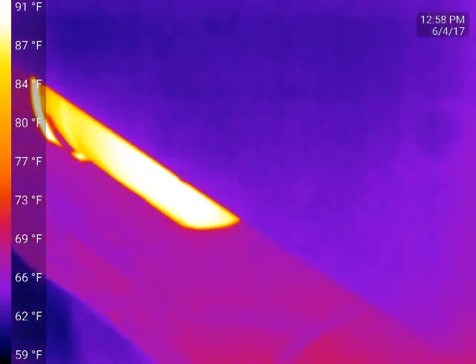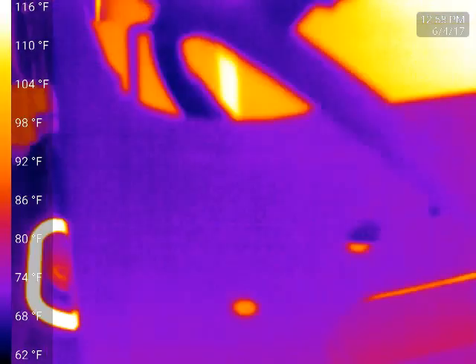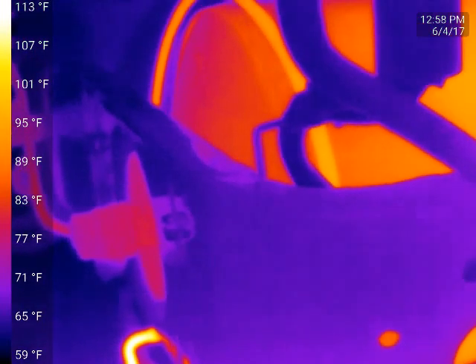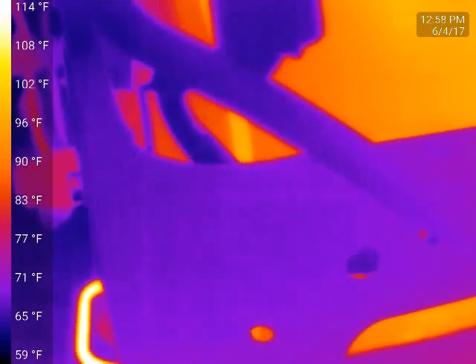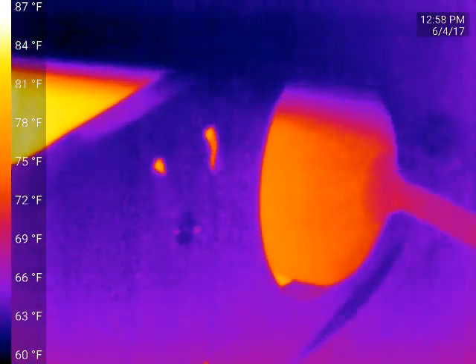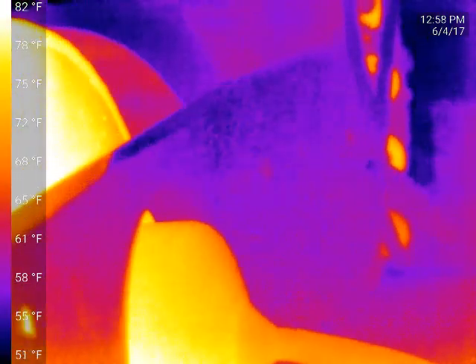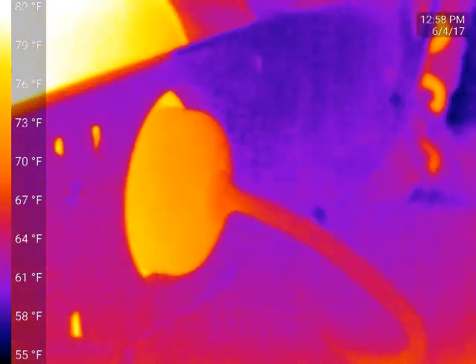While that warms up, this is a 1947 GE, and it actually just kicked on here a few minutes ago. That really bright one down there is the discharge line, and then the compressor itself — it's a horizontal hermetic compressor with external springs. You can see some of the air-cooled condenser up there, and if I get in the right spot, you should be able to see the fan flutter a little bit.